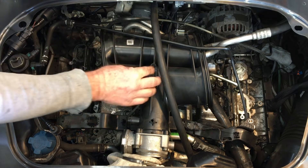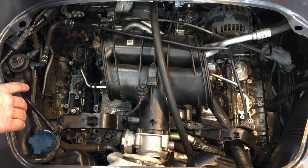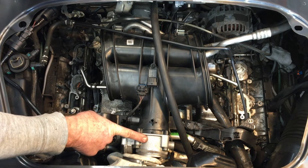There's a single screw there — this thing just wiggles out, and then you can plonk the new one back in. That takes 5 Nm to install. You've got the throttle body here.